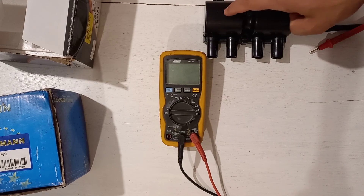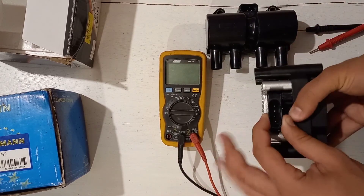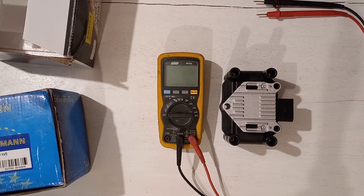If you have a really low ohm reading on your coil, you need a separate driver. If you have a really high reading — as we saw with the smart coil — it doesn't need an additional driver. That's basically it. I hope this is helpful. I'll link the forums and pinout sources in the description. Good luck with your endeavors — like and subscribe!